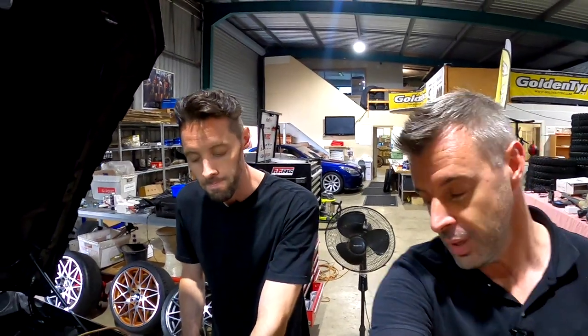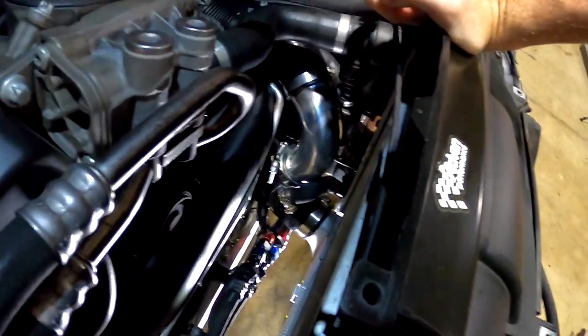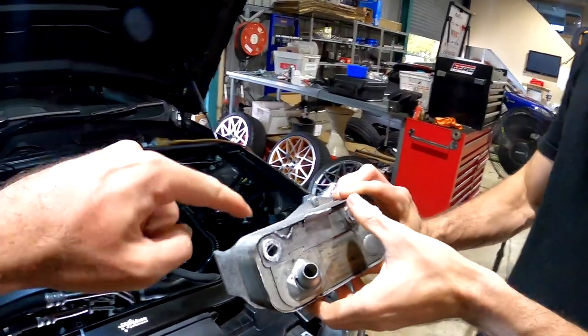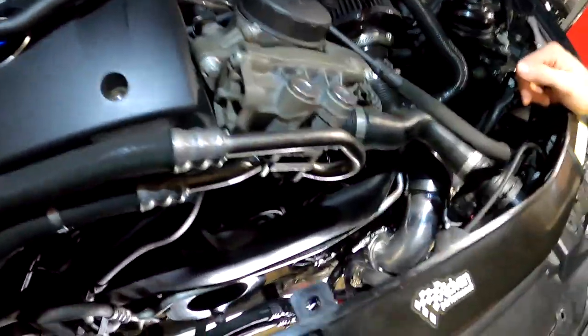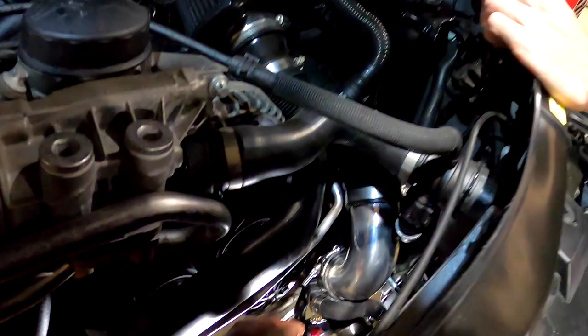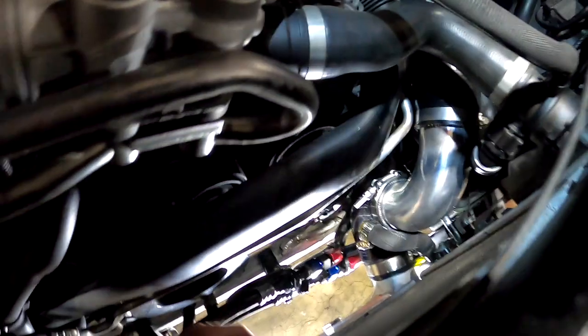So it's no longer yesterday — that was a bit of a shitty day, didn't go to plan. With the factory heat exchanger for the transmission in place, there was no way we were going to have enough room. We tried routing the cooler lines in two or three different spots, tried trimming things down — it was all because we didn't have bungs to bung the cooler line. All the shops had shut so we couldn't get bungs. But today I managed to get a bung from a local hardware store — a 15mm bung — which has plugged up the top hose. I've used thread sealer on the threads just because it is quite a deep thread and I don't want anything weeping through. On the bottom one I ended up using a 14mm sump plug. I will put a link to those down below so you can have them prepped ready before you attack it.